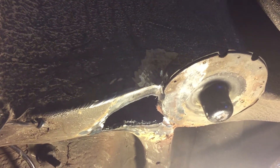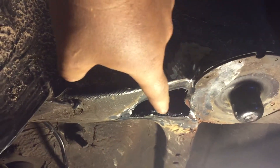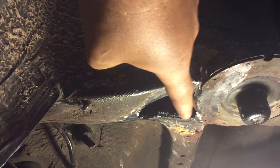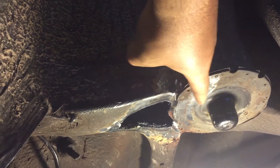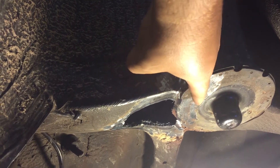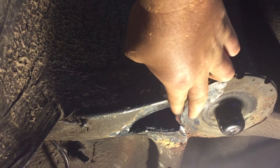I took the plasma torch out and I cut a bigger hole. I got a look at this side over here and there's a nice wall here. The rust stopped kind of right after that little spot I cut off, so I'll just be cleaning it up a little bit and leaving that. This looks good on this side now. I'll still be getting those blades in the morning and cutting a square just out of the top layer because there's two layers to this spring perch. I'll be cutting that out so that the plate fits in there.